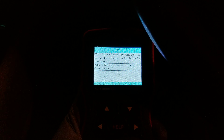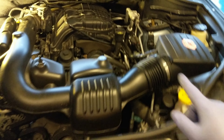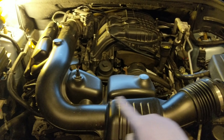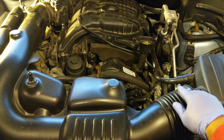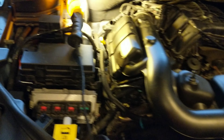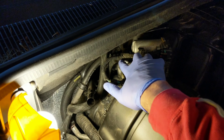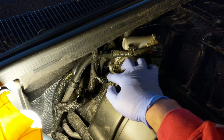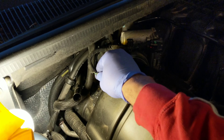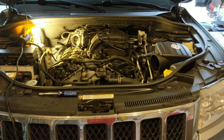For the rest of this video I'm going to show you how to take care of that P0128 by replacing the thermostat. First thing we have to do is remove this air filter tube. The front part is easy — get a screwdriver, loosen that up, and wiggle it off. Then come around the back — this screw is hard to get to with a screwdriver, so I used a pair of pliers. Pinch the sensor and wiggle it off.